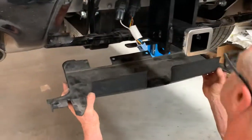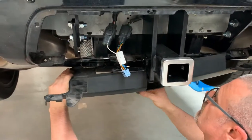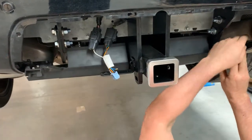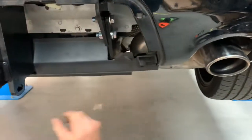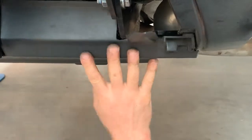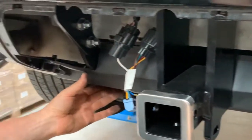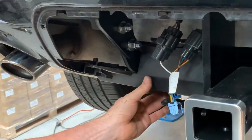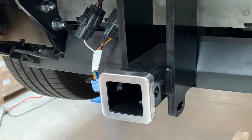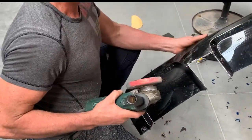What we've done is take the cowl — we've had two or three goes at this and think we've got it right this time. We've taken the section out from here to here. We may have gone a little low but I've gone down to that line to keep it nice and even. Either way it looks pretty good — I'll clean it up with a bit of 80-grit sandpaper. Let's see how she fits and bolt it up.